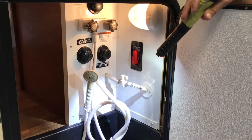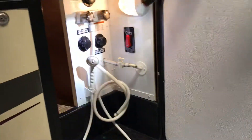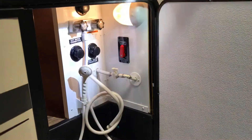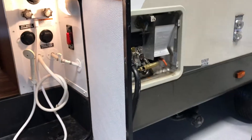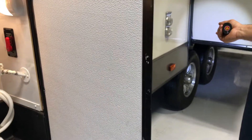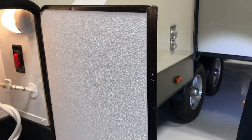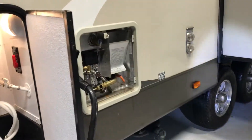And that's it — it's winterized. Don't forget to flush the toilet while you're doing that. That's how you winterize this unit; it's very simple. You can also drain your fresh water tank — there's a valve behind the axle back here, it hangs down. Those are the low point drains for the fresh water tank, and this unit might have fresh low point drains as well.